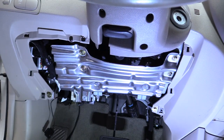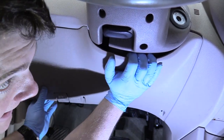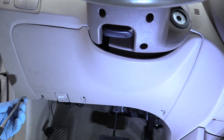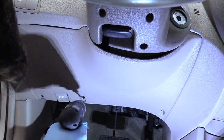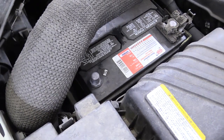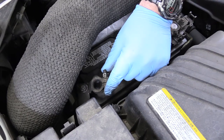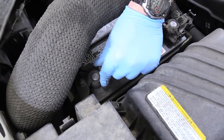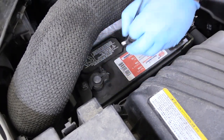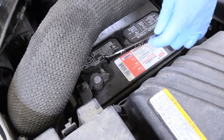We can put the kick panel back on. The opposite of how we removed it — we pulled straight out, so we push straight back once all the clips are lined up on their homes. Those reassuring clicks confirm it's seated. Reinstall the Phillips head screws. Now we can reconnect our negative battery terminal cable. When doing that, touch the cable end to the terminal carefully to make sure we don't get any huge sparks. If you get enormous sparks you want to be able to remove the lead quickly. Make sure you don't bridge the gap between the negative and positive terminals if using a wrench.